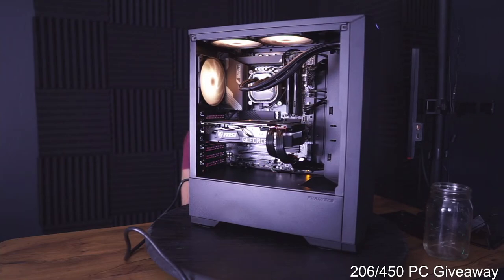If you already have 32 gigs of RAM, can you install 64 gigs along with the 32? No, Cake, this is a customer bought this PC. You have an 11700KF, 3.6 gigahertz with 48 gigs of RAM. Oh, so you have 4 12 gig kits then. Yeah, I wouldn't do that. I mean, 64 is overkill for like 99% of uses anyways, so I definitely would not mix and match.